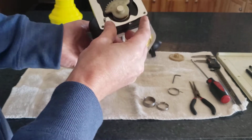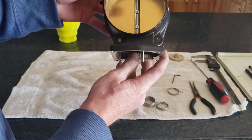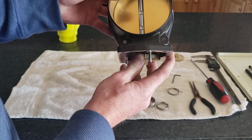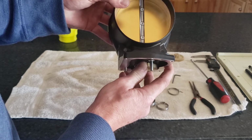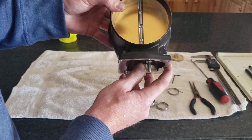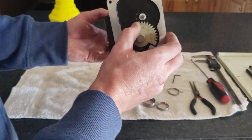So here there's a little set screw I can set as the throttle stop, and that'll allow me to ensure that the throttle blade is closing as much as possible while not sticking, because that's one of the challenges with throttle bodies. As these butterflies come to a full stop and actually mechanically rub against the housing ID, that throttle plate can actually stick and bind on the housing. Plus it's a wear issue. So that throttle stop will prevent that from occurring.